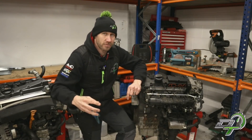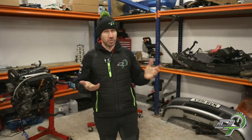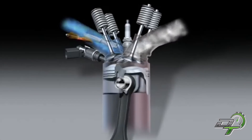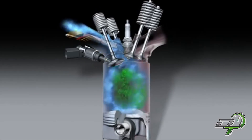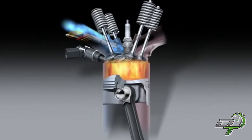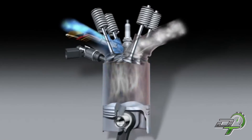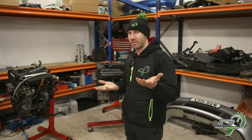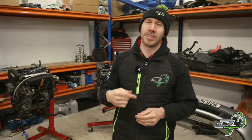On this engine, the injectors are mounted in the cylinder head and can fire fuel straight into the cylinder. This system does allow for a homogenous fuel mixture just like the 1.8T. It works like this: when the piston comes down on the induction stroke, the fuel injector injects, it mixes with the air that's been drawn in, and then it compresses and is combusted — simple as that.